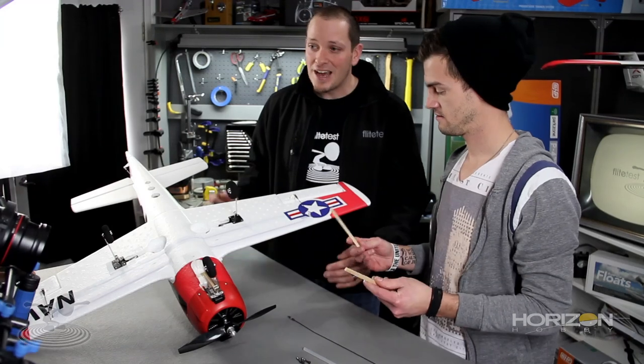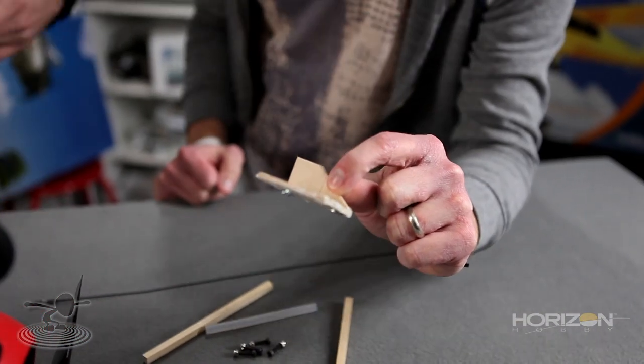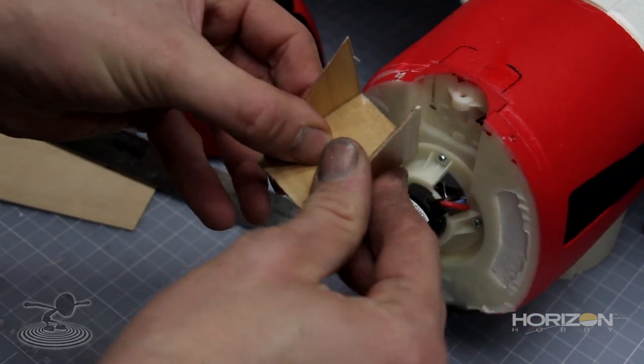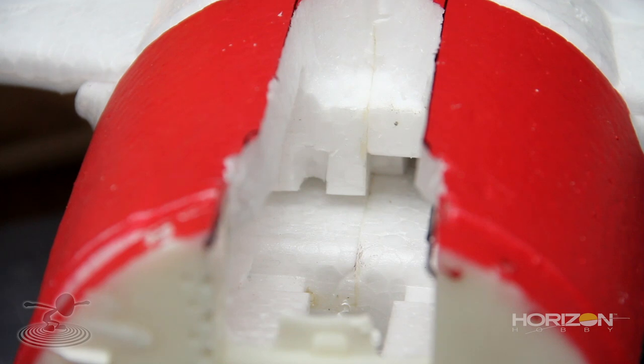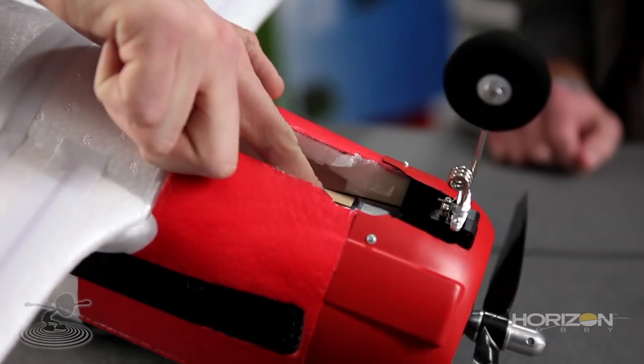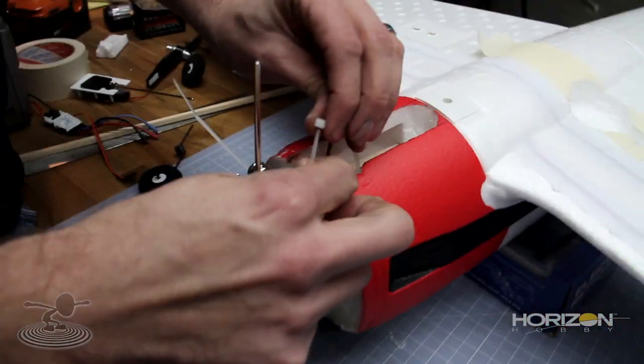Next are the sticks. Our first attempt was actually to make a plate that would sit down in here and fasten on both sides, without cutting through the firewall. The problem is, with a hard landing, all that force bending back — the only thing holding it to the structure would be just the sides. It'll probably hold as long as you make nothing but nice landings, but we don't live in a perfect world. So what we did is use these longer sticks. There's a nice hard point underneath here and you can stand those sticks under there extended right underneath the hard point of your wing. That's your lever. Your fulcrum is going to be right up on this firewall, and right underneath the firewall you can actually drill two holes — and that's where you use the zip ties. You zip tie that sucker in, so it's really, really strong.